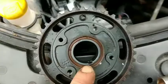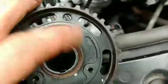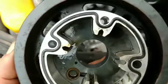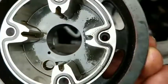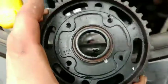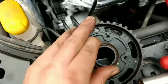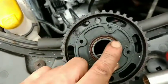Or between the lip of the seal and the shaft — because this is the actual shaft that the lip sits on, you see there. This outer part around here wouldn't matter if these bolts were loose, because the oil doesn't go through those; it stays on the other side of them. I could check the tightness, but I don't think it'll be there. It's already one solid piece, so I think it's definitely something in the seal, the camshaft, or in this case the phaser pulley — because that's the phaser pulley that it sits on.